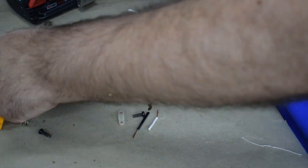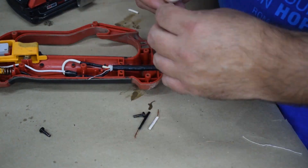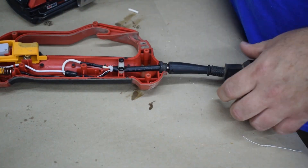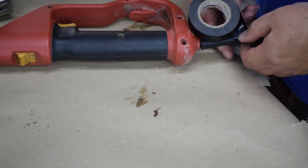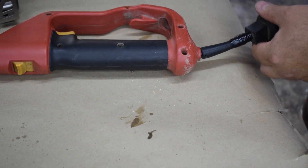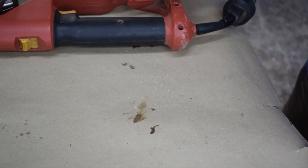Remember, those are hot whenever you're done — don't touch them. Put it all back in place and reattach all the bits and pieces that I pulled out of there, which are really very few. It's a very simple fix. And where that rubber thing was cracked, I used a little electrical tape just as some extra support. Then I plug it up and see if I managed to find a short.